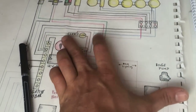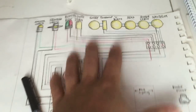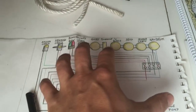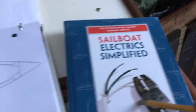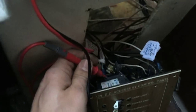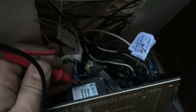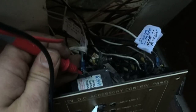I'm in the process of drawing out a wiring diagram. If I have things disconnected or find myself confused, I can always revert back to this. I bought this book by Don Casey, which you can never really go wrong with. I'm in the process of labeling all the wires and double-checking them by testing the continuity.